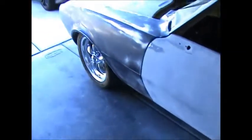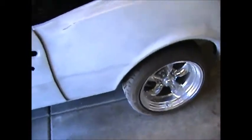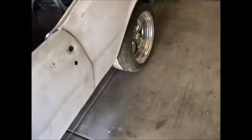We've got three body areas I wanted to get done, the hood being another one. Before we start, I'm going to block sand this down in 180 scratch. Hey fellas, the hood's blocked down — I did it at a 45 this way and then a 45 the other way. You can see the sanding scratches in it. Got a little feathering yet to do here but for the most part it's done. I still gotta break out the grinding wheel, grind this down, and open this gap up a little bit more — I'll do that before I prime it.